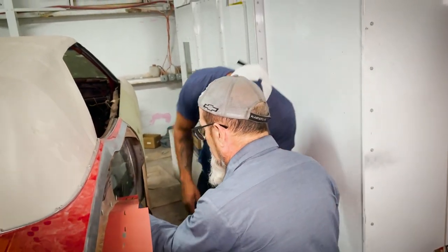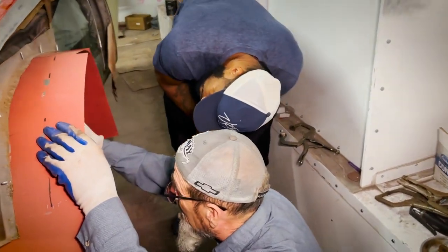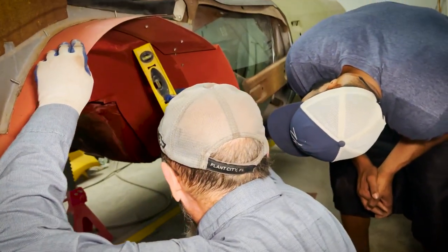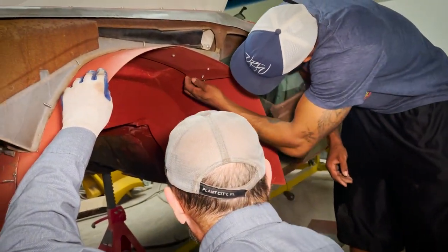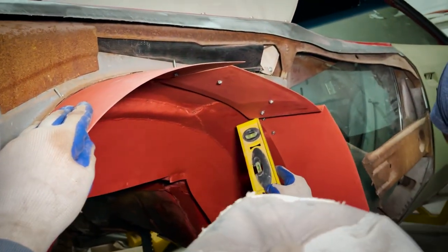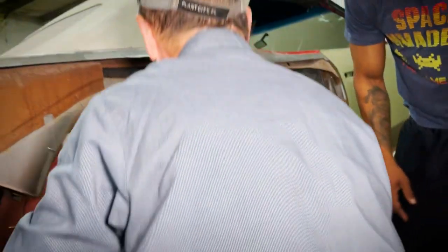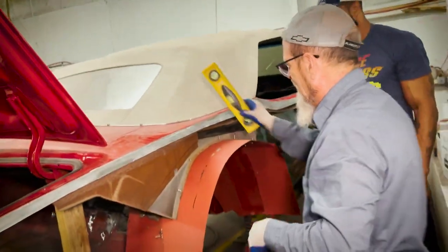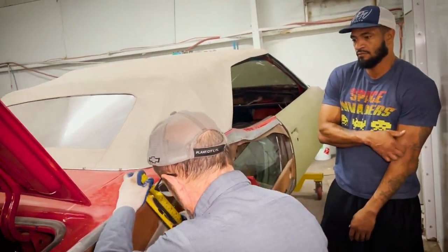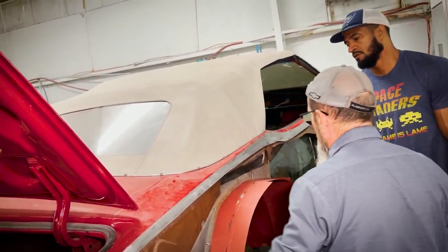This is bringing it right into the shape — this is basically the shape it's going to be. Then we're going to taper this in here because the tape is up in here. We're going to mark this, put a little notch here, and taper this up into here. Then probably roll this in right there where the gap is. We'll taper it, notch it, taper it in, and that way you just got the step up here for the roof. Then I'll cut probably this much off for now and set the quarter on.